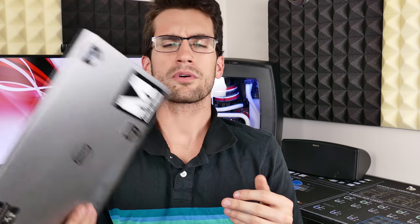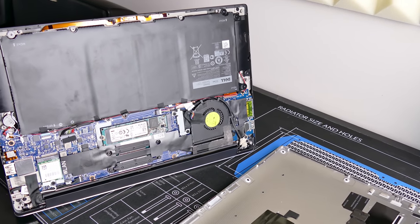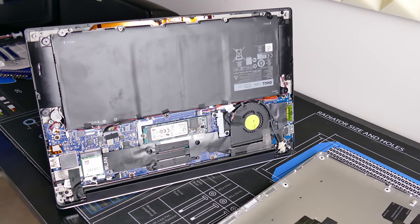That is excellent news. So the moral of this story: if you're willing to get a little down and dirty with your laptop, disassemble a few things with the necessary tools, you can swap your thermal compound and keep your laptop a bit quieter. I wish I had run fan noise tests before and after, because this is actually a quieter system as well, especially when running AIDA64. Your fan will not kick on as much, and when it does, it won't be as loud because your CPU core temperatures are being mitigated better. Apart from my little hiccup with over-tightening the CPU block, I do recommend this to anyone who considers themselves tech-savvy — and even if you're not, if you can find forums or teardown guides, the process is fairly simple to follow.